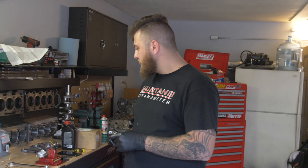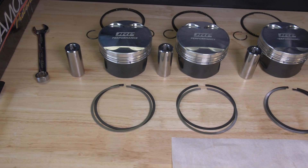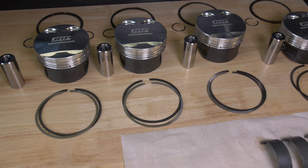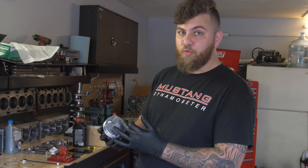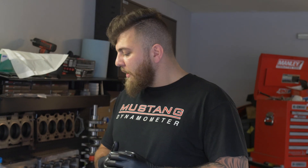As far as pistons go, I'm still using the JRP Gen 1 pistons for current builds. The new Gen 2 pistons are going to be Ronnie Built branded with laser etching. They'll also incorporate vertical gas ports along with horizontal ones, so you get better dynamic compression and less blow-by — the more boost you throw in the cylinder, the more you can keep it there. We've also moved from NPR ring packs to Total Seal ring packs on the Gen 2 pistons.